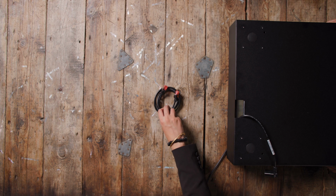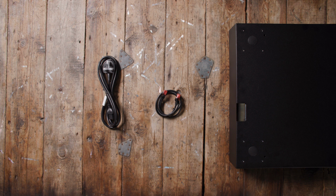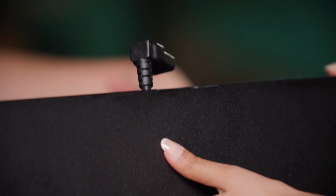To start, grab your cash drawer, the Ethernet cable that will connect to your workstation, and any power cords that require plug-in to an outlet or surge protector. Plug all of the power cords into a surge protector or other power conditioning device. Feed the power cords and the Ethernet cable through the hole in the back of the cash drawer.